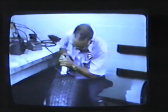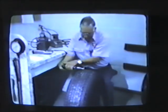In preparation for a wet test of another kind, this tire is being notched. The tread is cut away locally, and the rubber is ground off to expose bare steel belt ply cords. Then, as part of a long-term durability test program, the notched tires periodically pass through a bath of concentrated salt brine to test the adhesion of the steel cords in the belt plies to the rubber tread under severely corrosive conditions.